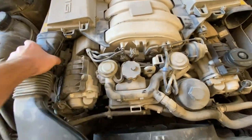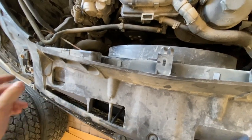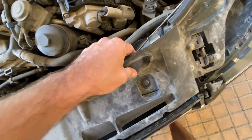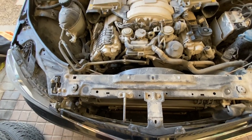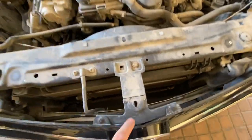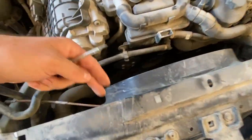I think the only alternative now is to start removing the radiator. We'll just start taking off these plastic air ducts which just pull off — super simple. We'll take this cross plastic piece off, then we've got to remove the fan. Majority of the stuff is literally just clipped in. For example, this plastic cosmetic cover — it was just one little plastic bolt in the front and then it has these retaining clips which you just pull back and pop off.